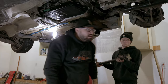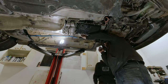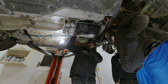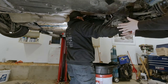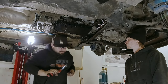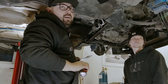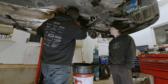Reinstall the front driveshaft - put the bolts in loosely as you rotate it 360 degrees, then on the second pass snug them down to ensure the flange is flat against the unit. Luke is removing the original transmission pan which had a big crack in it. It has an integrated filter, so we're replacing with a brand new OEM one. Unlike the 6HP, the 8HP pan bolts end up bottoming out, so you don't need to worry about a crisscross pattern - just tighten one opposing the other and go around snugging them down.